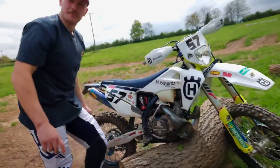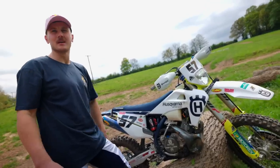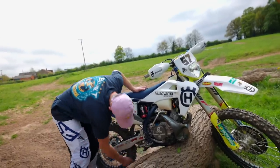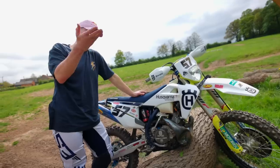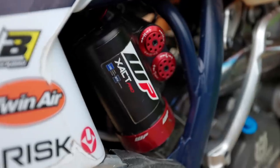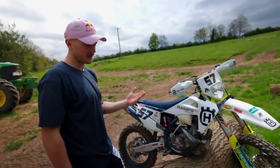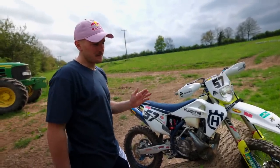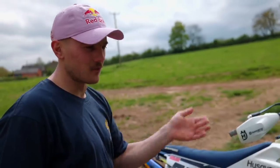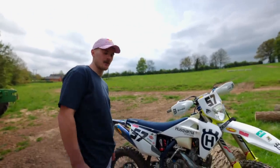Skid plate - very important for hard enduro, essential. Otherwise you're going to put it all on your engine probably sooner or later, and squash your frame. And if you have a Husqvarna, or Gas Gas, or any other bike other than a KTM - good linkage protection and also slider, so you can cruise over the logs with ease. Track shock - talked a bit about suspension earlier. On the softer side - I run a lot of sag on my extreme bike because I feel like it makes the bike lighter and easier to move. I probably run too much really, because I struggle a lot with my front end lifting. But that's mainly just how I feel comfortable for the rest of the track. I'm slowly jacking my back end up a little bit more to try and get on Manny's level on them climbs.